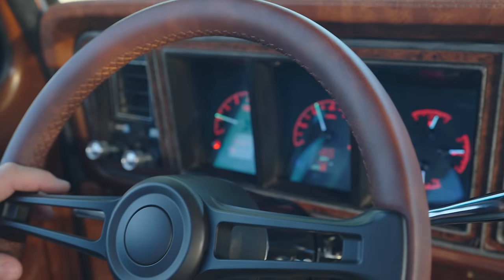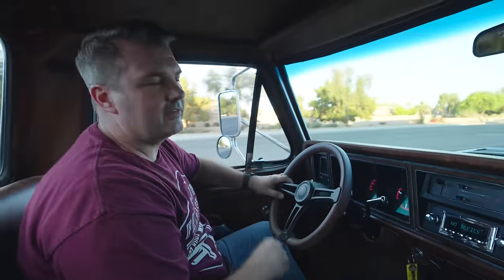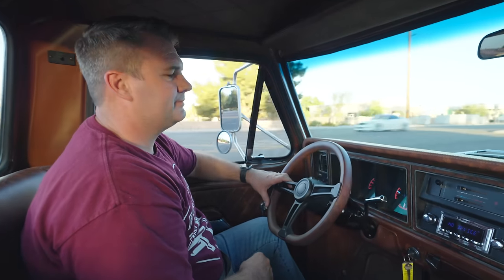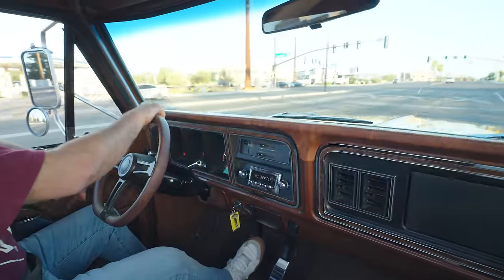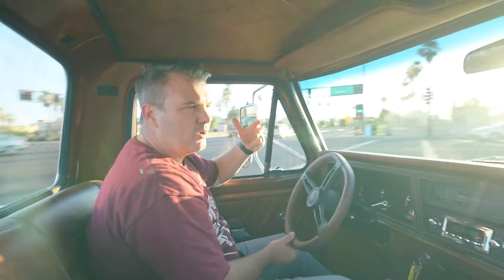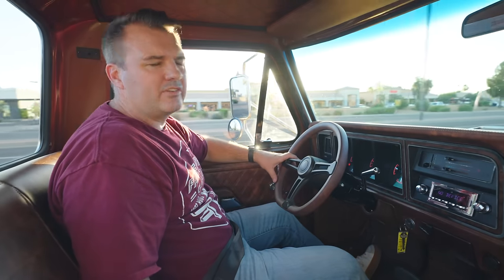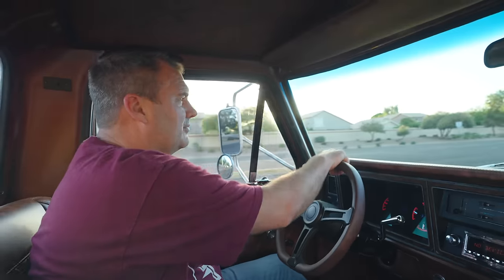Oftentimes there's a little bit of conflict when you try to put the indicator on your column and work it on the dash - they don't always jive, so just get rid of it on the column and it's a little bit better. It's very responsive as you saw. We're using a brake booster and a master cylinder to stop - you can get 12, 13, 14-inch rotors. We're using an 8-inch brake booster and it seems to stop well. This truck has 12-inch rotors on it and it feels really comfortable.